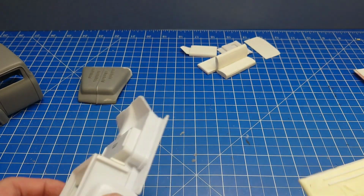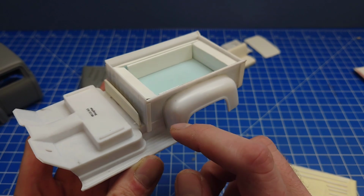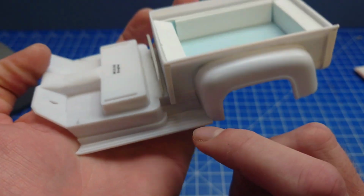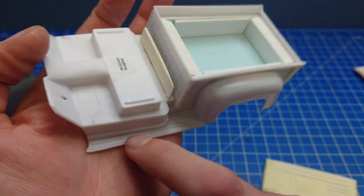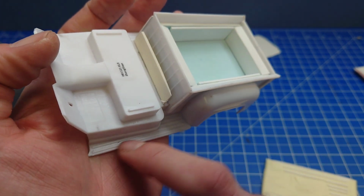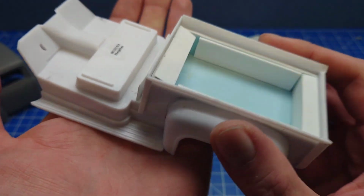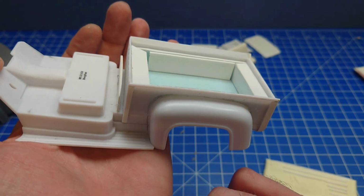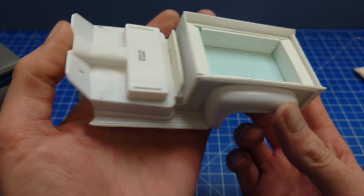Last thing so far, for the bed and the cab floor and running boards, is for the mountain pearl. Has these painted in candy red, and just the tightness of all this, and then the thought of masking it after paint. I could have based up with red first and then put a line on top of that, but even doing straight lines like that, because all my fenders are in place and everything, it just makes it really difficult. And that's where my problems would be.